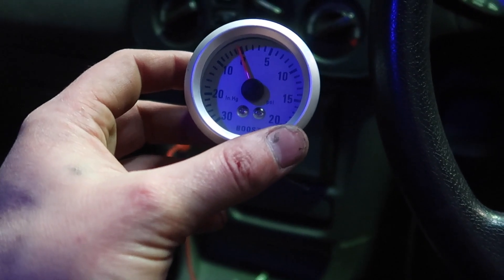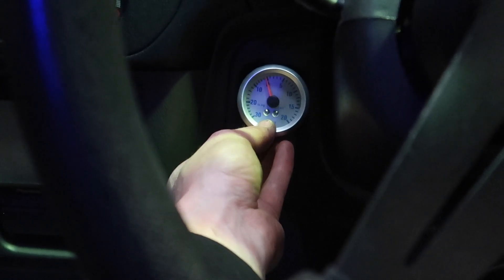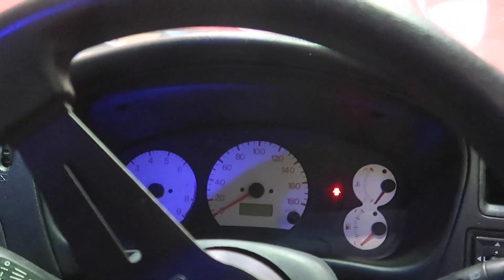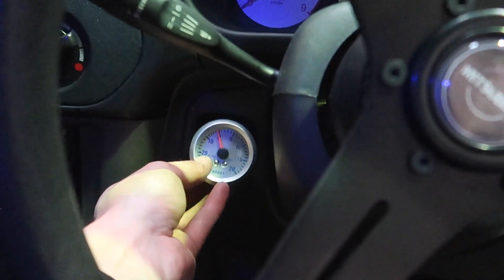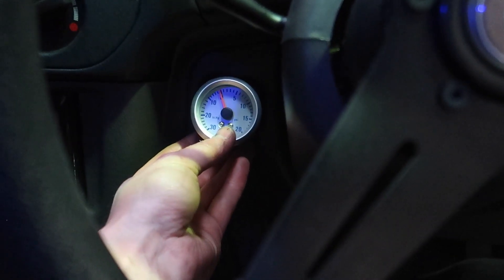It'll show us whether we're actually reading boost. I'm sure it's accurate within one or two pounds. There's this little divot down here which looks like a pretty sweet spot to put the boost gauge - I'm going to have it sitting nice and tucked away in there. I could have it up here on the dash, but this evo dash just really gets me going and I don't want anything in the way. So down here is just a nice spot - we'll hole saw a hole through here and have it sitting up nicely on the angle.